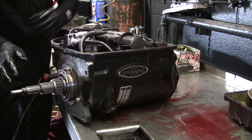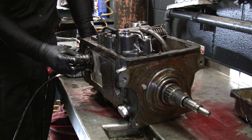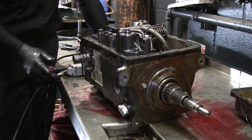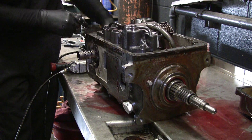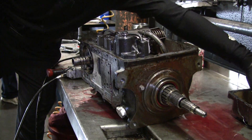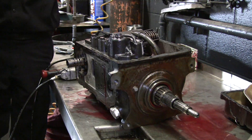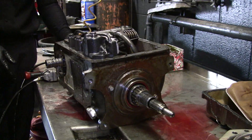Here's a bunch of stuff — we saw the brains on that. The brains were hooked on here along with this housing back here. There's your governor. When the car is moving, the governor spins around. There's also another pump here that has a pickup that hooks into this back hole — that's the rear pump, they call it.